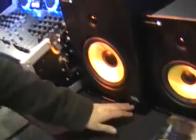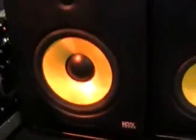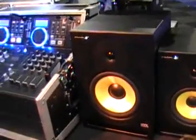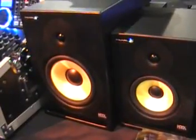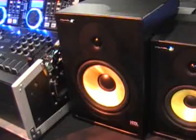Yeah, and also slot ported from the front. Oh yeah, look at that. Which gives you the best natural sound. A lot of speakers are ported from the back, which means that they will sound different in different rooms. If you put them in one room and they're too close to the wall, they will sound completely different to if you move them to a corner.